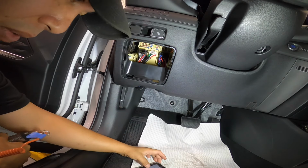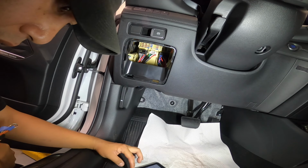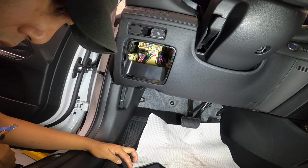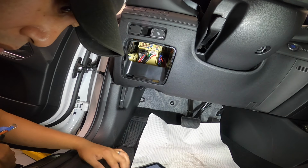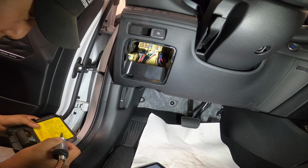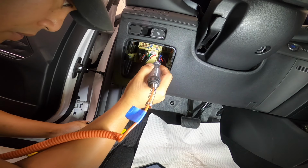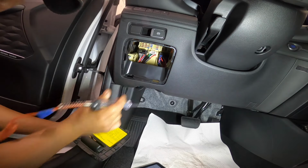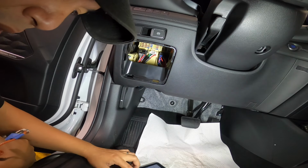I'm just gonna go to our turn signal wiring diagram. I just wanna see, because there's a fuse there too. I'm just gonna go double check that fuse quick. Module 8, 7.5. 1, 2, 3, 4. Okay, so there's power there.